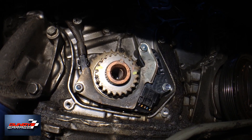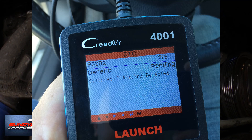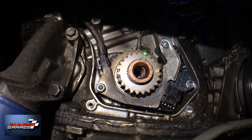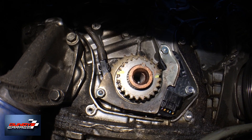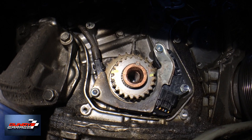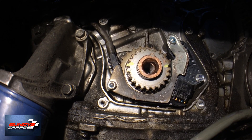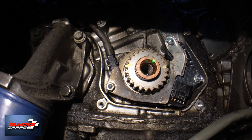So we're getting misfire codes. It was the rear bank, cylinders one, two, and three. What I need to do is take the tensioner off, reset it, and bring this back around to the 12 o'clock position so that these marks line up, then reinstall the belt. It's also a good idea when pulling off your original belt to mark the front and rear cam in two spots. And make sure you don't lose this Woodruff key right here — make sure it's in there when you put everything back together, otherwise you'll spin the cog and the timing belt will be really messed up.